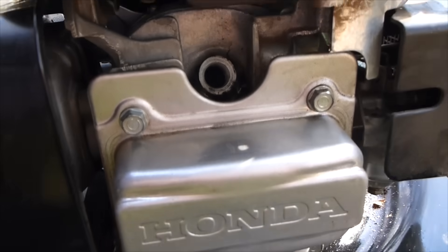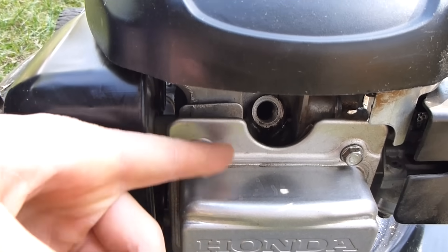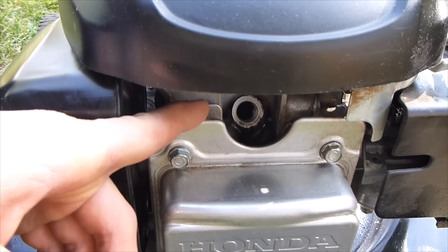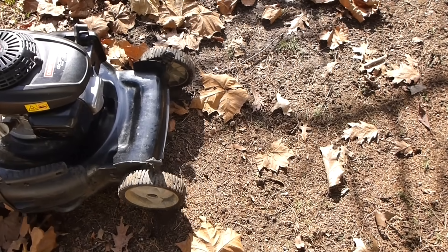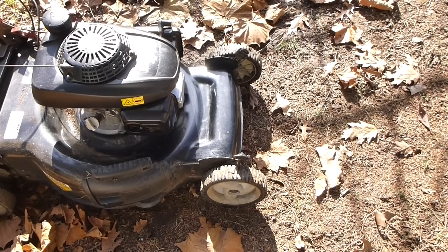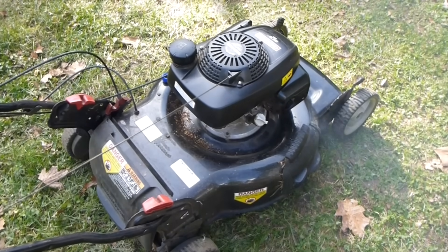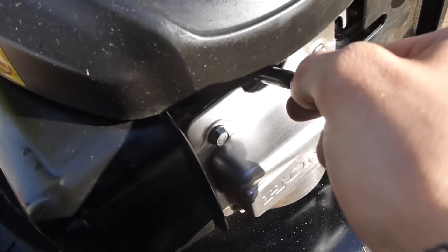After a 10-minute soak, I'm going to keep the spark plug hole open and try to start the engine. What's going to happen is the piston is going to push out all that liquid. Liquid is not compressible, so I don't want to damage the engine by mistake. Even though there's not that much in here, I don't know the tolerances of this engine, so I'm going to get most of that liquid out first. With most of the seafoam out, let's put the spark plug in and start the engine. Soaking the seafoam on the piston head actually cleaned off all the carbon really well — there are just little spots left, but pretty much the cylinder is clean.